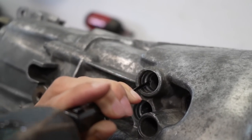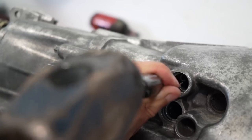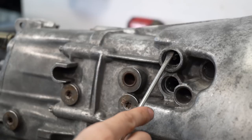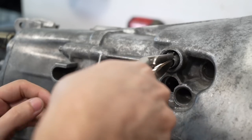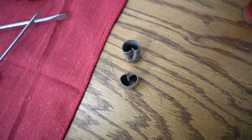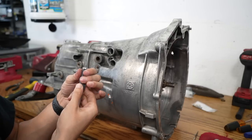I'm just trying to get behind it. It literally got right behind it. I need to be careful — that shit went in. I was just trying to stick the screwdriver in there and pry it down to give me enough room to grab it so I don't drop this in the transmission. Moral of the story: if you want to save a lot of time, sacrifice a tool and grind it down so you can get behind that sleeve. I'm gonna use a little piece of thousand-grit sandpaper around a 10 millimeter to clean up the marks I made in the cylinder.